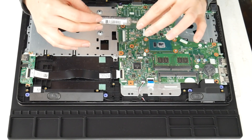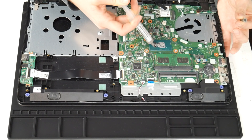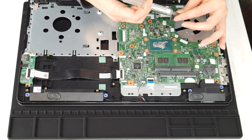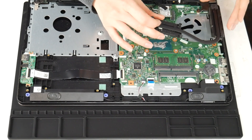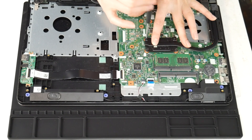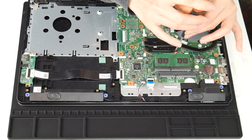The next thing I'm going to do is use some thermal paste on the CPU. I forgot to clean off the CPU before doing this, but I do recommend that. As you can see, it's dried out and there isn't much on there. So I go ahead and put some new thermal paste. I've put a link down below with some good quality thermal paste because not all thermal paste is created equal — you've got to get the good quality stuff. Put your heat sink back on — there are four screws and it is kind of like putting a tire on. You have to go one screw and then across to the other screw at an angle so that you don't get one side tighter than the other.